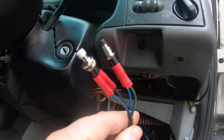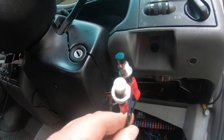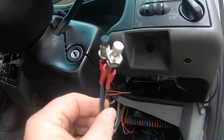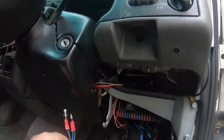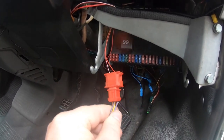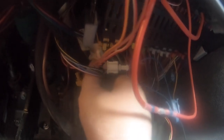These are the little micro switches I'm using to set and resume the cruise control. I got these from Alex Whittaker on the T4Ever Facebook group. They plug into the cruise control socket using a Mark One Golf connector — four pin. I just want to show you below the dashboard where the cruise control connector is — just over here, this is the four pin socket that it gets connected to.